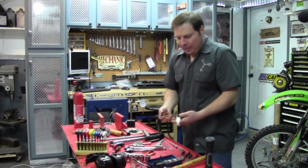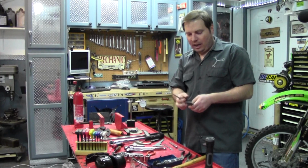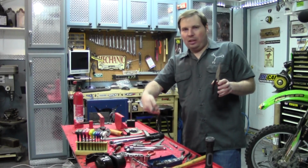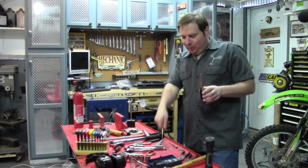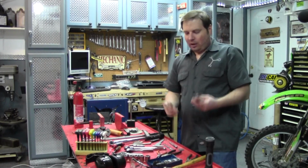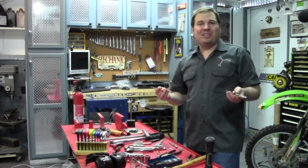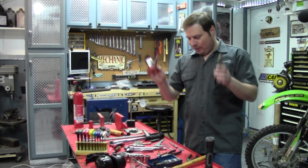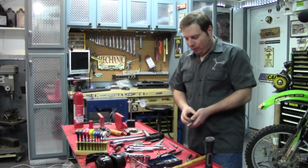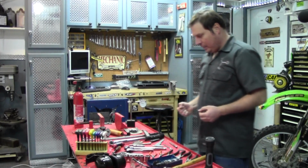The other thing is needle nose pliers. Now these are for like cotter pins and things, and when you reach in and pull out something kind of tiny, you'll want two sizes, something around like this. This is kind of nice for small things, and maybe in the carburetor just picking up little parts, and this for larger stuff. Also diagonal cutters, you'll probably want two different sizes for cutting wire ties or baling wire if the previous owner of your motorcycle kind of bodged things together. Buy the best you can, because the better ones are sharper and last a lot longer, but even the cheapies will work, especially for zip ties and things.